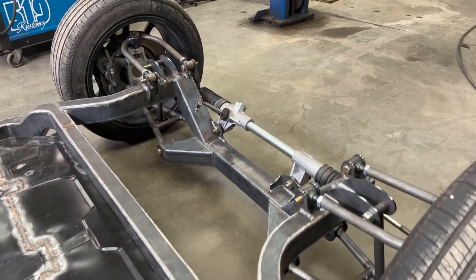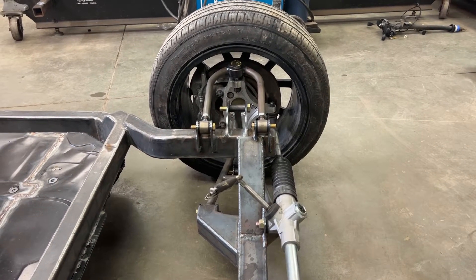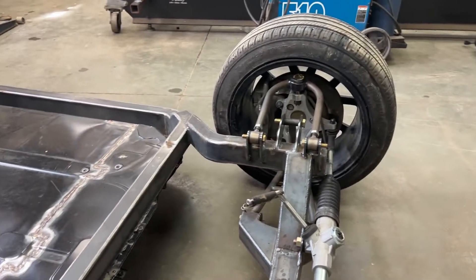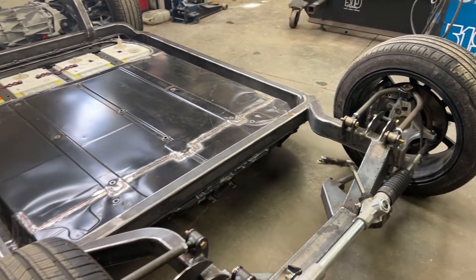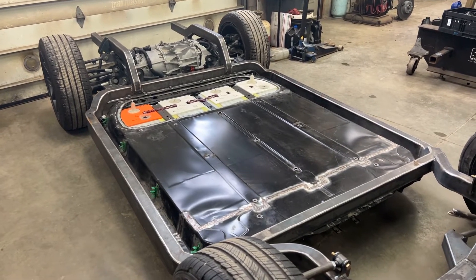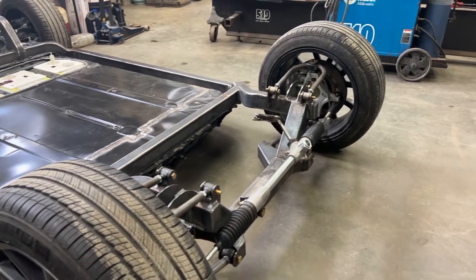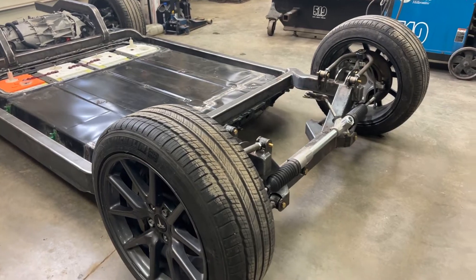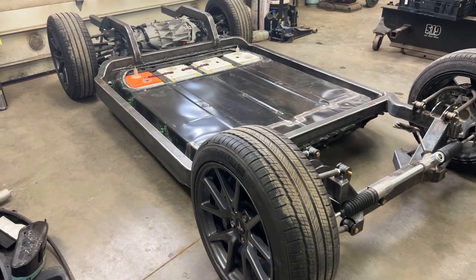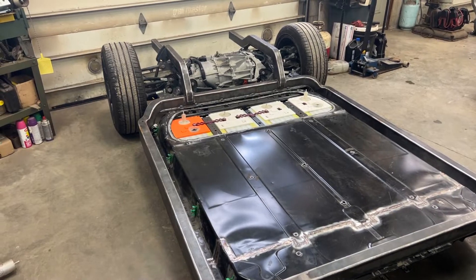Normally the chassis extends out another 16 to 18 inches from here, giving you mounting for the front bumper, core support, and that sort of stuff. But this is getting attached to a unibodied car — that's why I cut this thing off as a stubby front end. Once the unibody is welded to it, the front of the donor car makes up the whole rest of the structure for the front. So this is actually going to end up being a little kit car — a Ferrari kit car — but rear-wheel drive electric. So the purists are going to love me for that one.